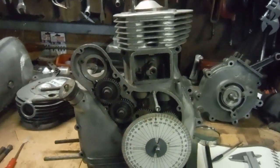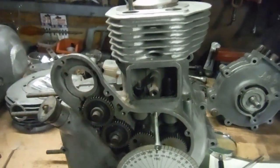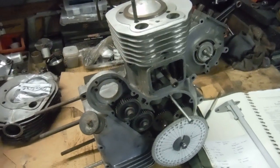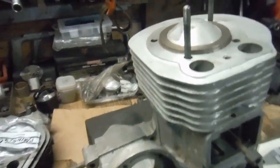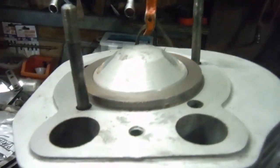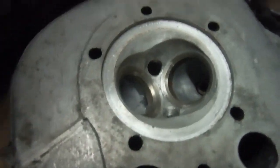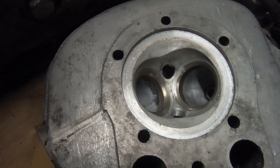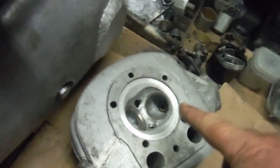I have here a rather long stalled project of my own, and it's included in the ASBO count of engines that are built and tuned, but I never quite completed this one. It's a Redditch 350 — I lightened the crank, I shortened the cylinder barrel, and we've got a Meteor Minor sports piston in there, which has also been machined slightly at the crown. I've got one of my last squish banded cylinder heads, as per the spec of the original 350 race engines I built.